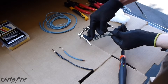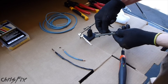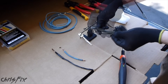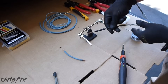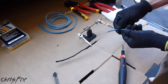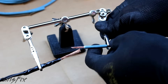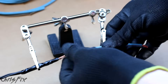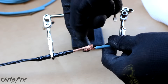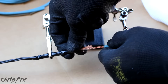Since the area where my fusible links are located is really tight, it's hard to get good camera angles. So I'm going to show you right now the proper way to attach a fusible link to a normal wire. Here's our normal wire — it's a black wire — and here's our fusible link that we're going to be attaching. Whenever you're doing wiring, it's always good to have something to hold your two wires. These things are cheap, about five bucks — I'll put a link in the description. It just makes your life a lot easier. The first step is to get your fusible link and the wire you're attaching it to, and blend them together.